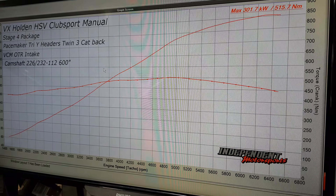Really, really good street cam — super efficient. It's got around 52 to 54 kPa at idle, which is actually really good. The stock engine is around 40 kPa, so you don't lose much manifold vacuum, and it is really efficient on fuel. It makes really good power without having to tip a lot of fuel in, which is what we're looking for — we don't want to waste fuel with overlap. This cam really ticks all the boxes. We rate this as a 10 out of 10.